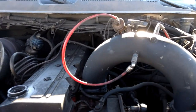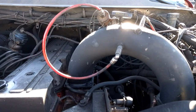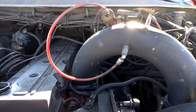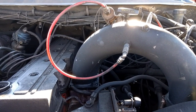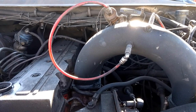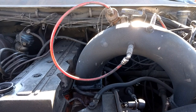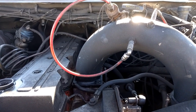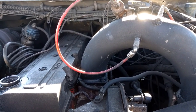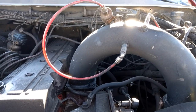Okay, so you're gonna have to excuse my engine — it's dirtier than crap and it's cold outside, I don't feel like cleaning it up. First thing you need to check is your oil. Make sure you've got the proper amount, done all your scheduled oil changes, and you're running the proper oil. Next thing to look for is if it's over full. If you're getting oil from somewhere — the injector pump front seal can blow out and dump fuel in your oil, which is a very bad thing. You don't want to drive it that way, but you should be able to tell if your oil is over full.